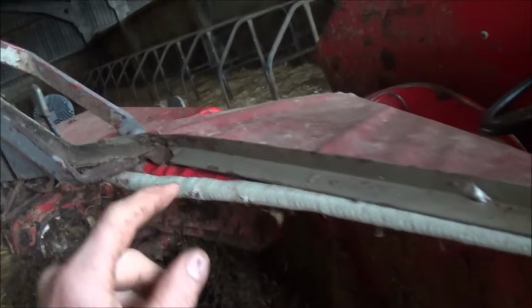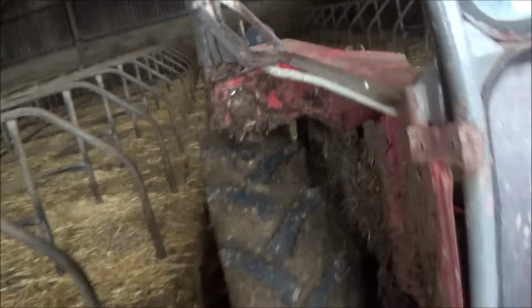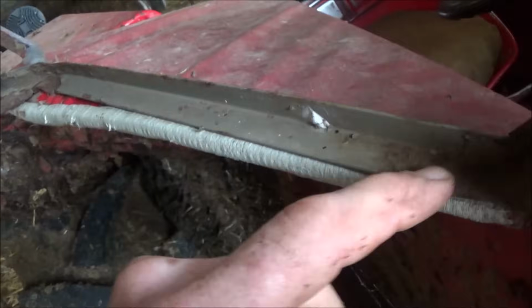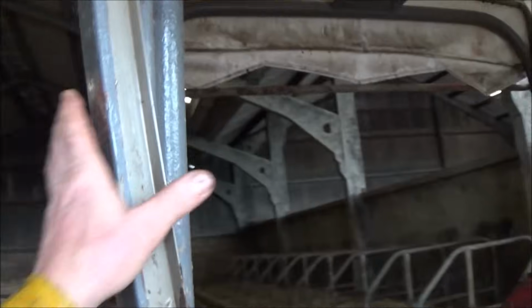Right, that's got to come out here. I don't even know whether they can put the glass in that really if it's that knackered. Look. Here it is. That's what it should look like. Otherwise put a piece of Perspex in there because that's a bit more flex. The trouble is no flex is there with, if I can straighten this piece out, that'd be alright. At the moment that's no good, is it? You can get the glass back in there then, and then the chap can fit it. Might be a lady. Alright. I mean, the thing is, the glass gives the door rigidity, so if you haven't got the glass, it's all a little bit more likely to bend and buckle anyway.